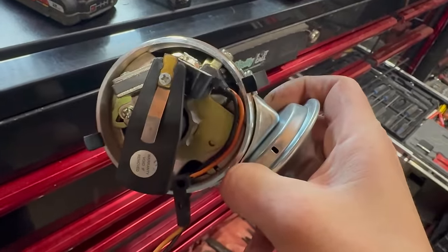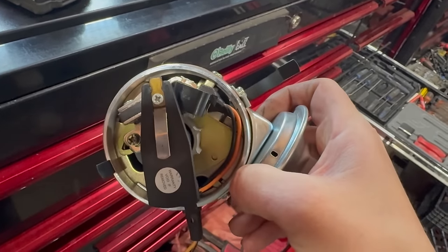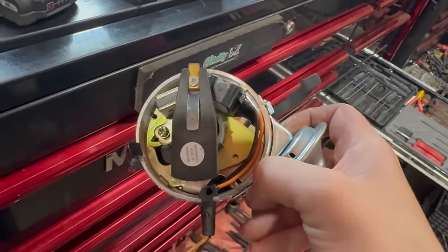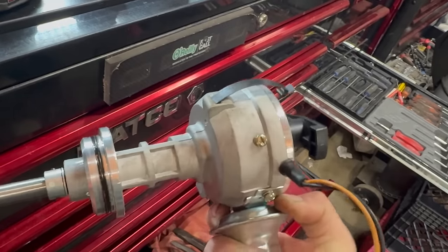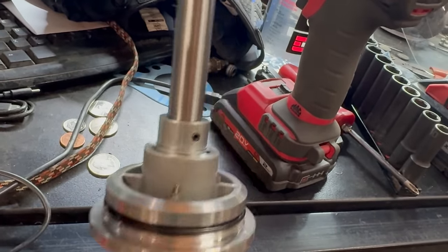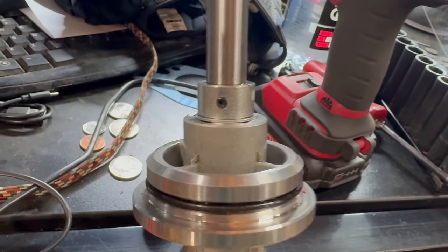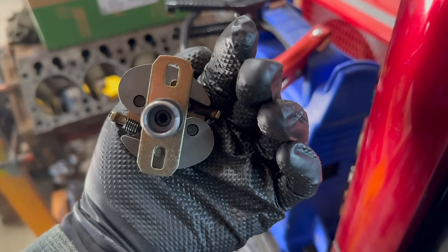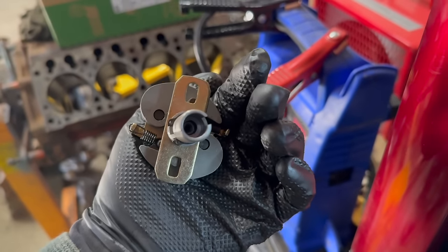Anyway, if you don't feel qualified to tear into this thing and weld on it and put it back together, don't. Either find someone that is, or take the easy way out. Go over to Summit Racing and buy their knockoff of the Direct Connection Mopar Performance adjustable unit. Thankfully, this thing has a steel sleeve instead of the old school nylon. The nylon retaining sleeves break often. On old production distributors, there's a snap ring down there you have to take out. On these newer ones, it's a Phillips screw. I'll take the Phillips screw, thank you.